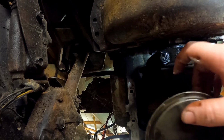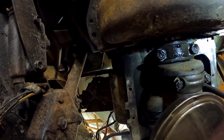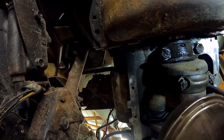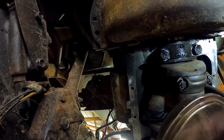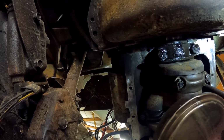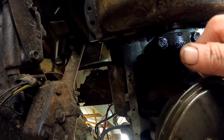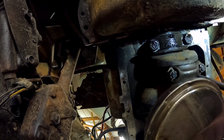We're going to clean up this pickup and some of this other stuff. Maybe brush this crank with a little bit of steel wool, then blow all this out with some carburetor cleaner or brake cleaner, and just clean out any residue of dust, because if you get any kind of dust in here, we don't want that mixing with the oil, because that's not good. So we'll get that all cleaned up.